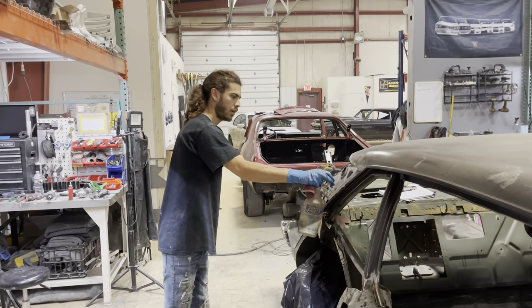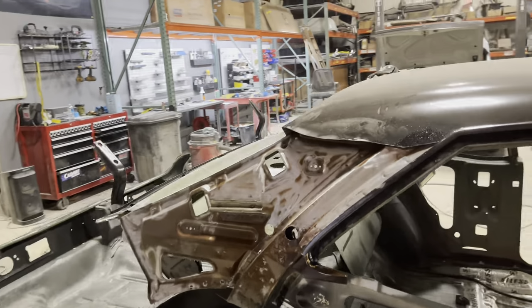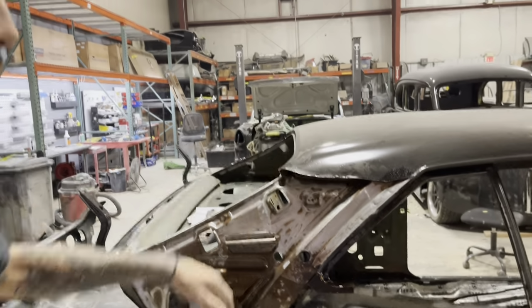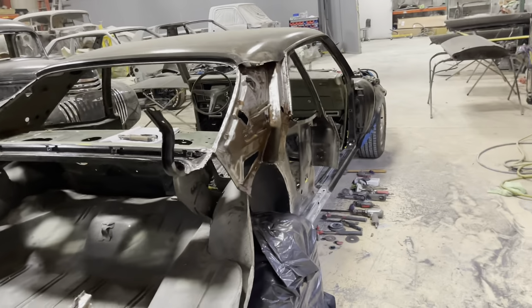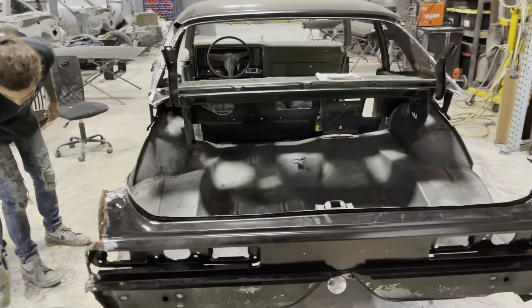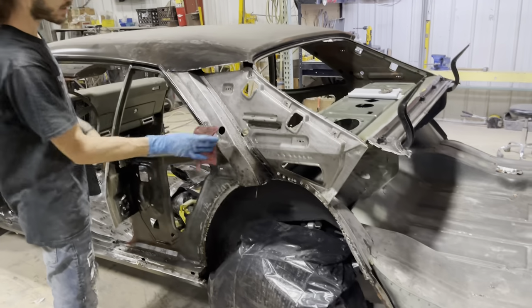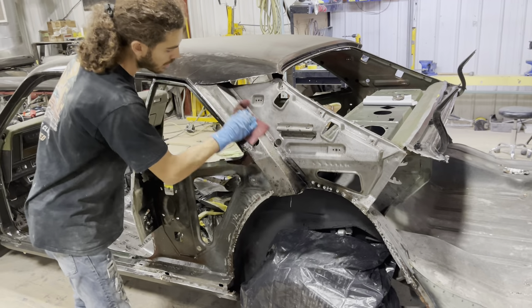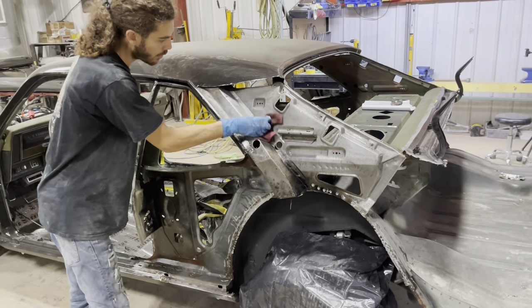So, you can see in here, Jesse hit it real quick with a wire wheel to start with. It just kind of knocks the scaling off, makes it a little easier. This is kind of what you can expect to get. And this is after that same process. That looks great. I'm just Scotch Brighting it. It'll get rid of all your rust.